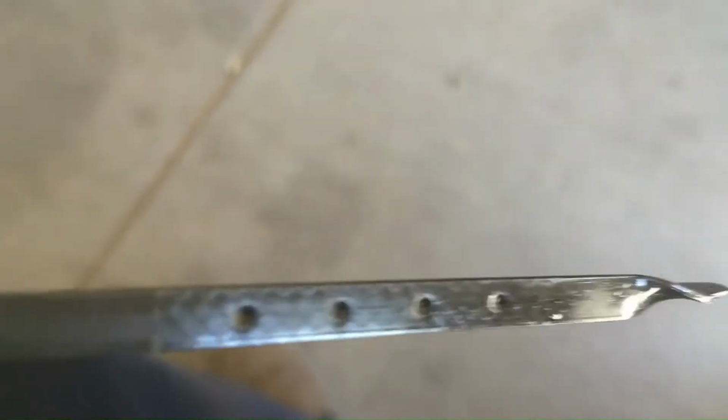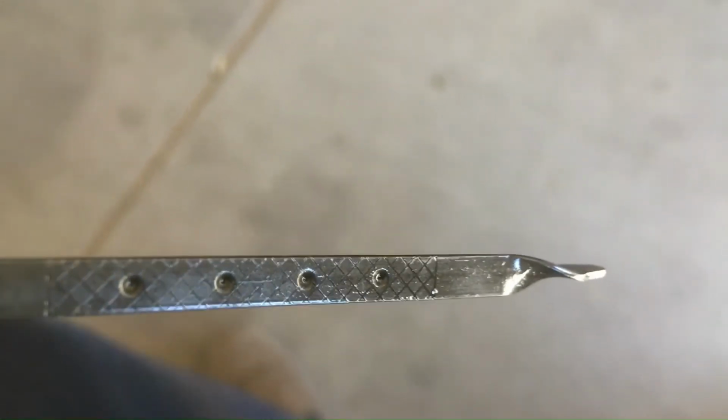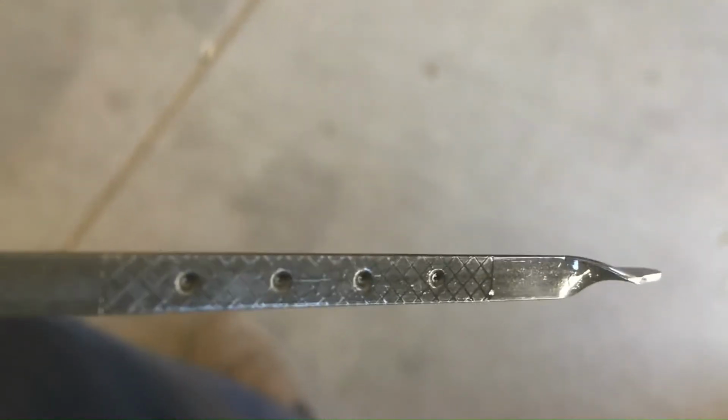If you can see, I've got it focused in on there. You do not want to be past that last part of the hatch. That little line right there, if you go past it when it's hot, that's where oil leaks start happening. So I would say go between the third and fourth hole, or maybe just a hair past the third, and you're at a good range. Of course, you never want to be lower than the first hole.